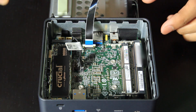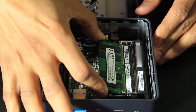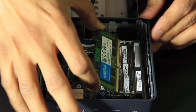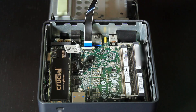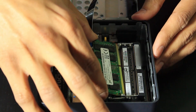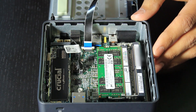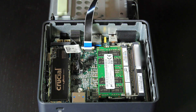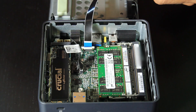So that's the hard drive installed — we'll move on to the memory now. There are two chips here that need to be installed: two 16 gigabyte Crucial chips. When installing the chip you will see there's a little groove on it; you need to make sure it's the right way. If you try to put it in the wrong way it won't go any further — it will stop you from pushing it in. So we'll flip it over, install it the right way, and you will actually see the gold pins slightly disappear as you push it down.